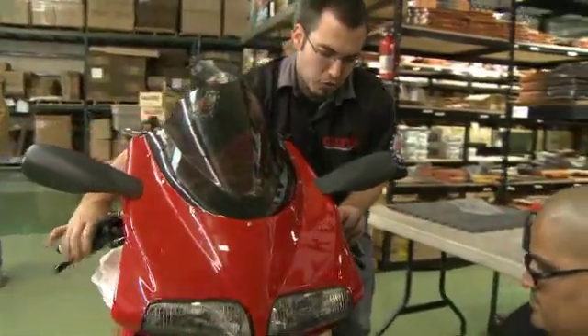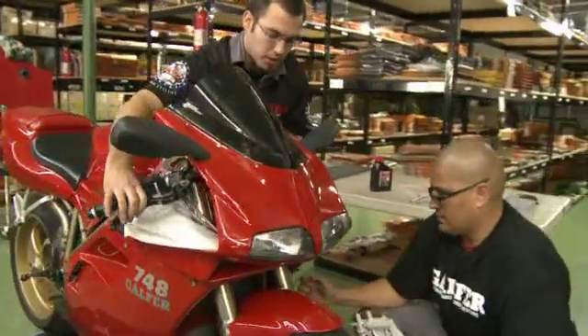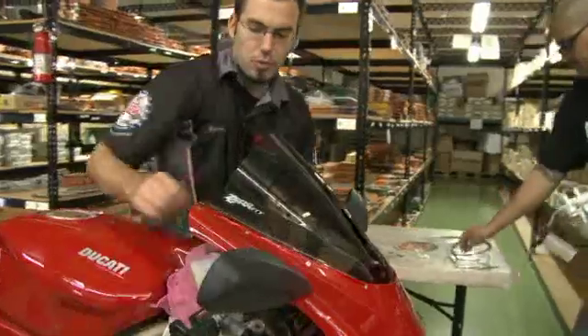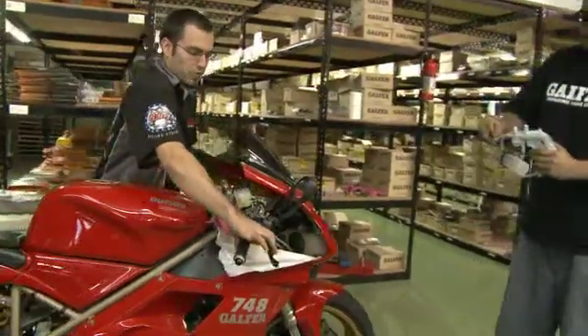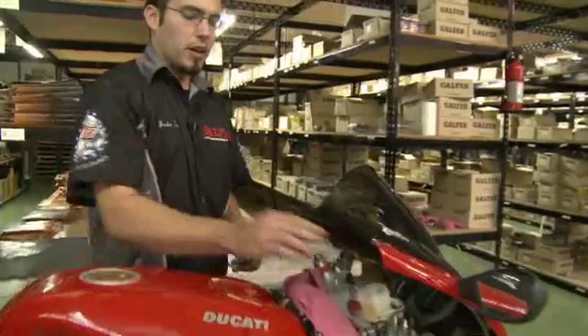Continue back and forth to the left and right calipers until you have no air bubbles coming out of the line. Once that happens, you're good to go. Make sure the fluid in the reservoir is still between its minimum and maximum — we usually set it right in the middle of the two. Then put the cap back on, making sure you have your rubber seal over the top, and screw it back on. That's bleeding your brakes.